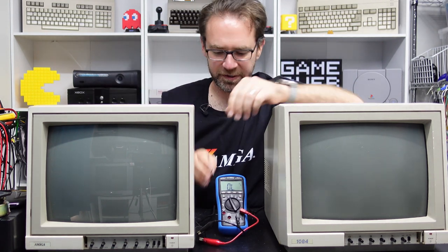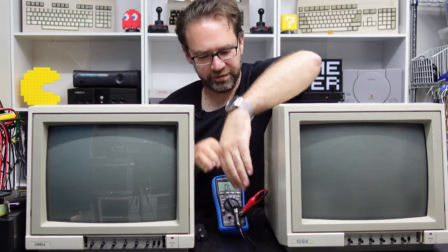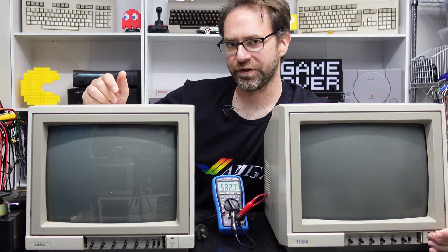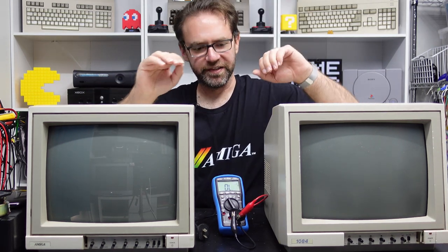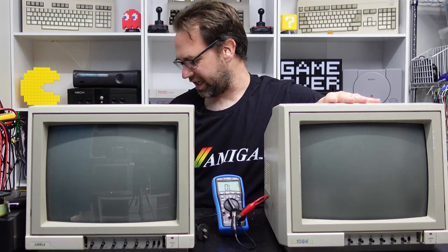They generally always read a low resistance when you put a multimeter across the actual plug itself — it is not a dead short, so don't break out the paper clips just yet. Likewise with the other monitor, this one just won't latch at all, and I'm not going to sit around holding the power switch to use the monitor. They both also need new switches. These are a little bit different to the 1084S — the power switch is mounted at the front and it doesn't have an IEC connector at the back, these are hardwired.